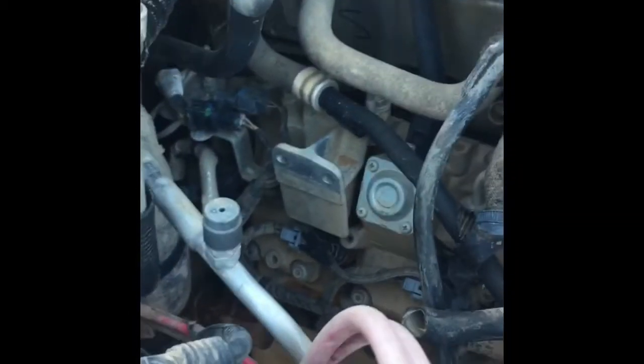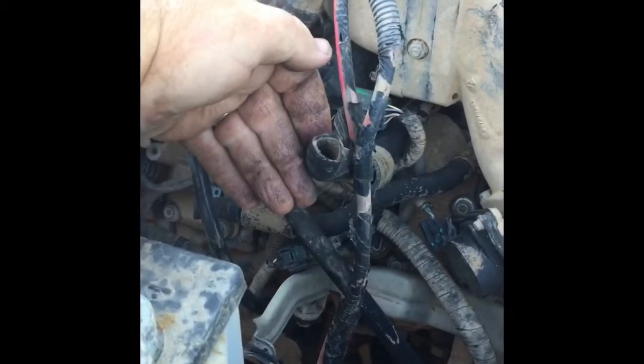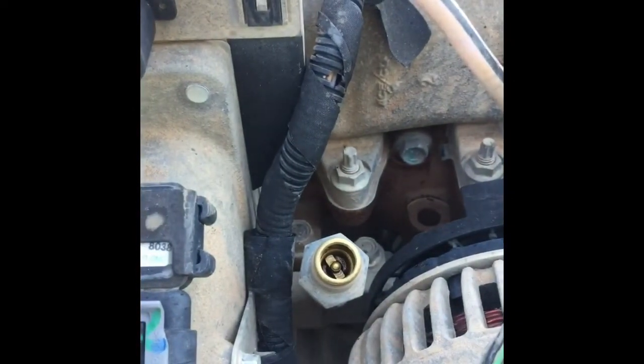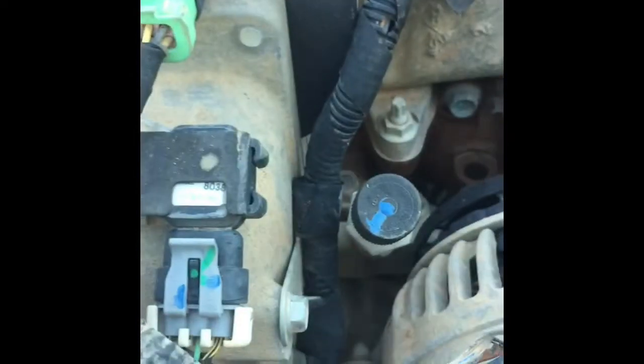So what we're gonna do now, since like in the other truck they cut the fuel filter primer assembly out of there for whatever reason, we got to find which hose goes to the CP3, which I'm investigating is this one here. Sorry, I'm a back cameraman by myself. This goes directly to the, you'll see the test port back over here, and also the CP3, which is where we want to plumb. See, it goes to this port here, but you unscrew this, that's a test port, and also it bleeds off extra air, which is really nice.